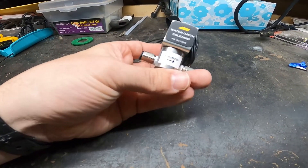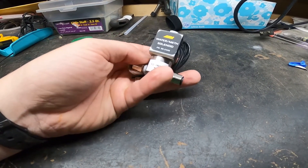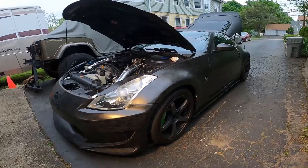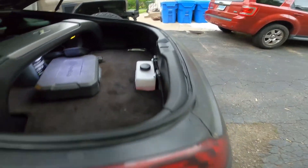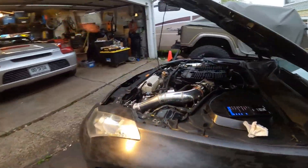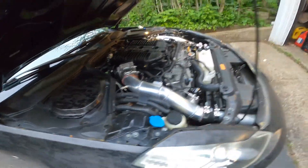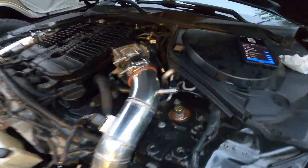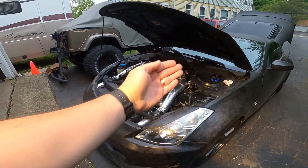We're gonna try and install this. I'm over at Nick's house and we'll see if we can do this quick and easy. As you can see, going to the back here — there's the tank for the boost juice — and then it gets routed all the way up here. You can see it tees off right here, and then these lines come in and feed into the intakes right before the throttle body, and that's on both sides. We need to add the switch right before the T-section and that will cut the supply and hopefully prevent the car from shutting off. We pulled it inside from the rain.